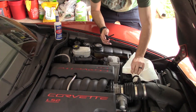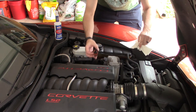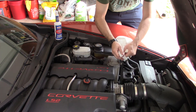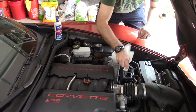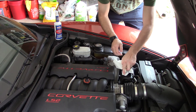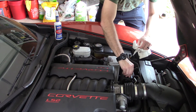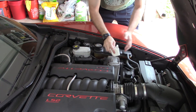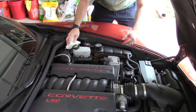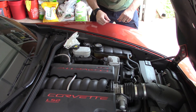We'll wipe up some of this. Anytime you've got an open orifice on your car like this, you always want to wipe away from it — not across it — so that you don't push dirt down into the hole you just created. Our cap is snug, our fluid is cleaned up, and that's that. Thanks for watching Maintainer's Garage. Have a great day.